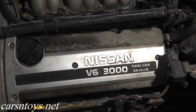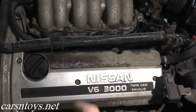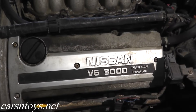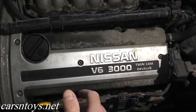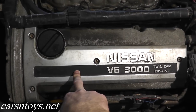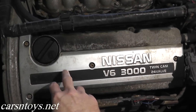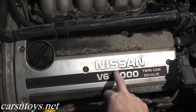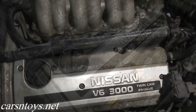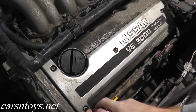What you want to do is test each ignition coil. The first thing we'll do is a power balance test. What that is essentially is turning on the car and then disconnecting the ignition coil. If we hear a decrease in RPMs, then you know that the ignition coil on that cylinder is firing. You'll do that test on every one.